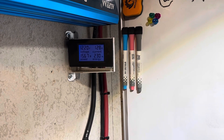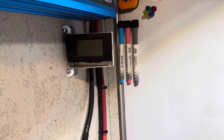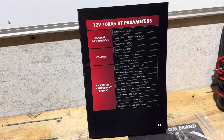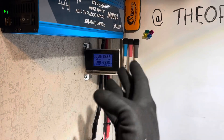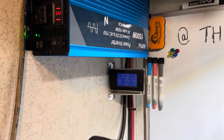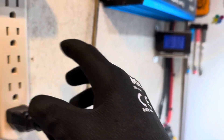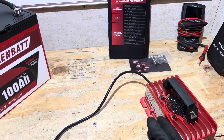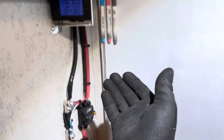There we go — 128 amps. The BMS shut off. The rating of 130 amps is right on the money; it only lasted just a few seconds and it cut off. The BMS just reset. Back to the regular charger — took the big charger off, back to the 36-ish amp load, 470 watts, 236 watt-hours through the battery.